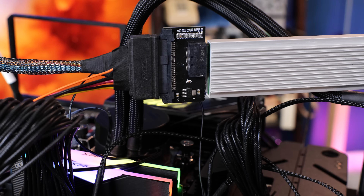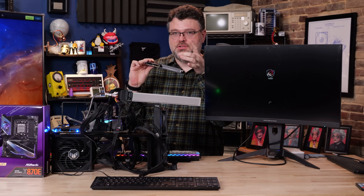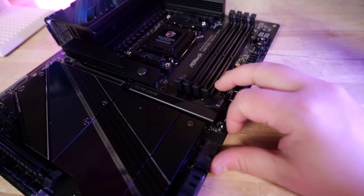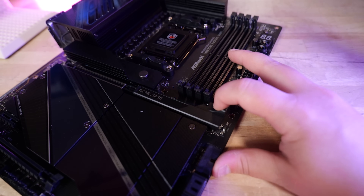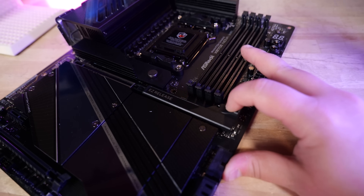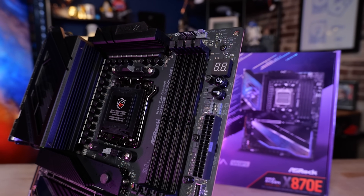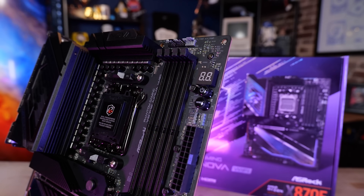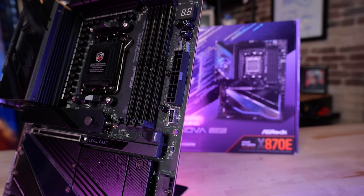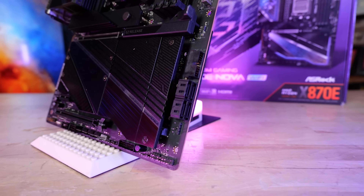These PCIe adapters are also compatible with E3.S — the flatter, more card-like variety. E1 is shorter and E3 is taller, basically for 1U or 2U rack-mount servers. There's also an easy release for the GPU, so when you change your graphics card it's easy to swap — the mechanism releases far away from your card. Overall it's a 20+2+1 power phase design — a nice motherboard for AM5, but not designed to be the most insanely overclockable board ever. It delivers solid performance with something like the 9800 X3D running at DDR5 6000.